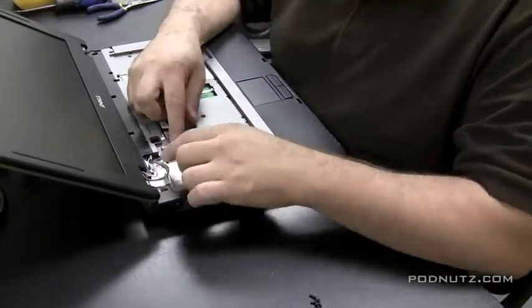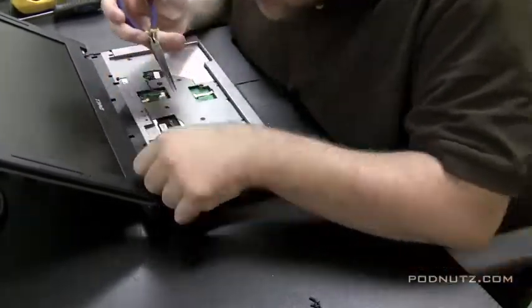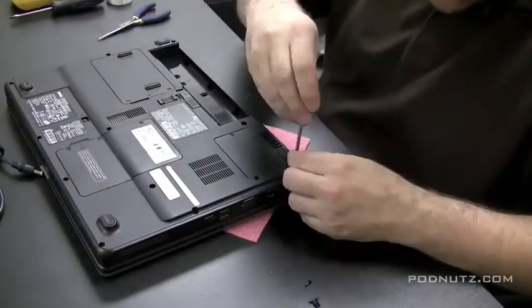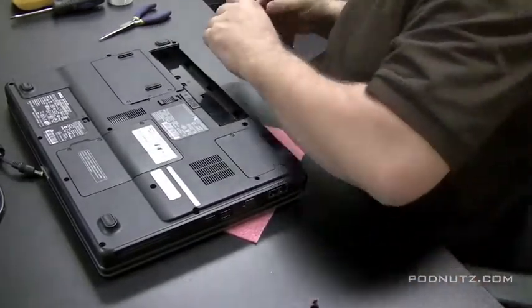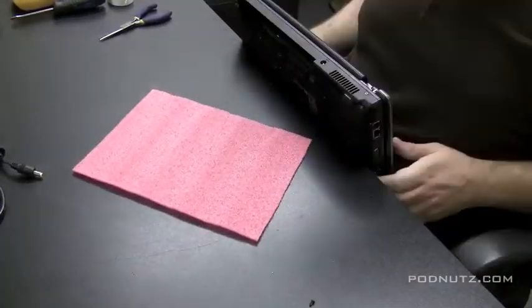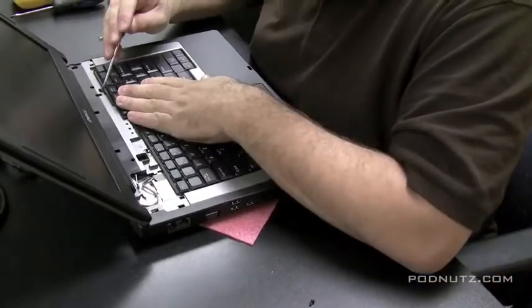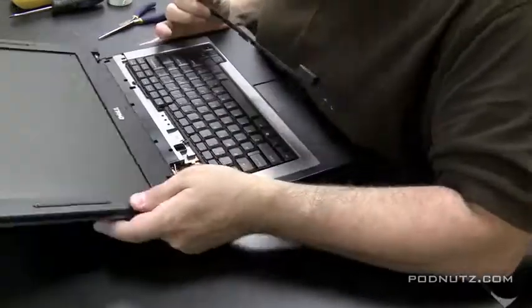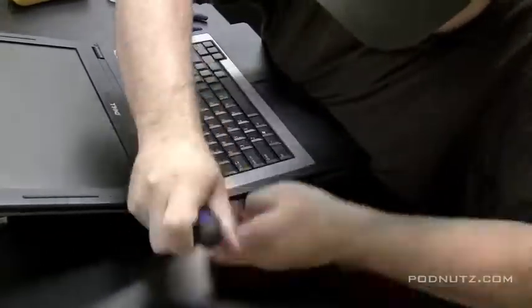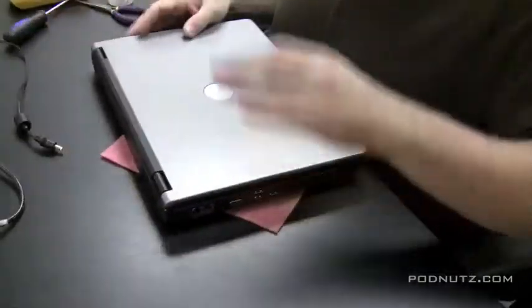Make sure you get all the screws in and put the CD drive in - held in by one screw. Get the screen back on, attach the LCD cable and the wireless card cable which runs up through the screen as an antenna. Screw in the hinge screws - those couldn't go in until the screen was in since the hinges have the threads. Put the keyboard back on, attach it properly, put the two keyboard screws in, then snap that panel back into place - we know it has no screws from the bottom. Make sure it fits exactly as it was when you took it apart.